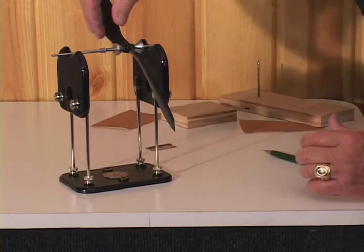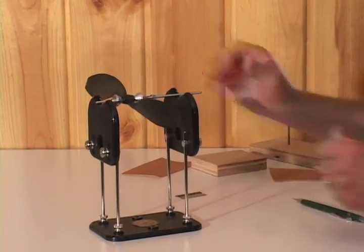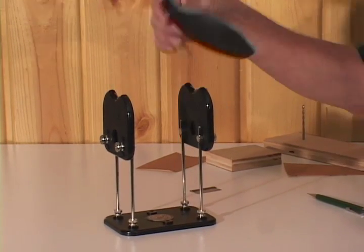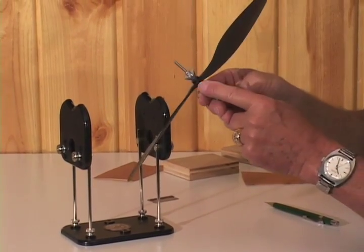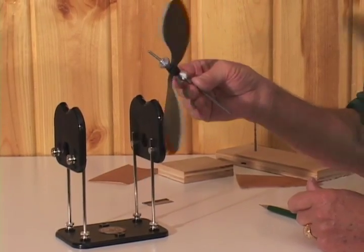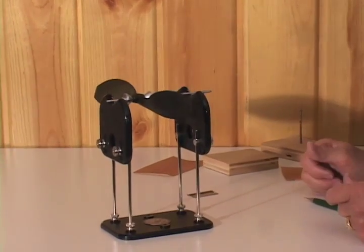Make sure it's right. One other thing: turn it around completely 180 degrees. If you find it's still off balance, and yet it's balanced the other way, then the problem is in the hub. On these smaller hub props, you don't have a problem because there's so much light material. On the bigger ones, like wooden ones, you would have to take something off the hub. Otherwise, your prop is nice and balanced.